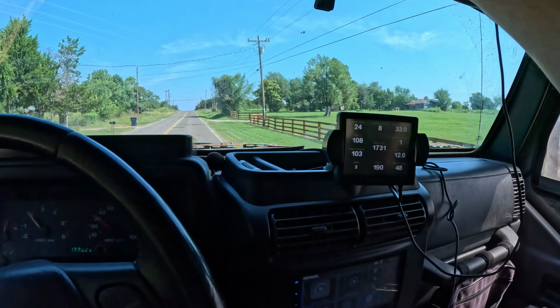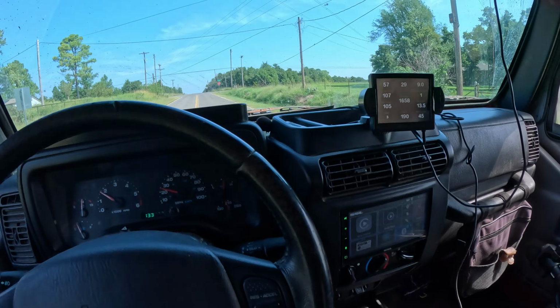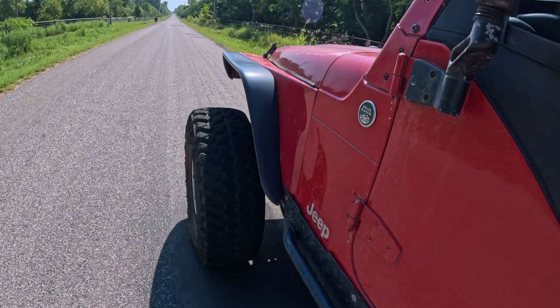I'm gonna slow down some. Hit it again, downshifts to first. To get out of all that, just turn manual mode off. That is pretty cool. So if we had a second switch, we can wire that up as the upshift. Essentially, we can have paddle shifters on the Jeep, which would be pretty cool. And just like that, the LJ is good to go.